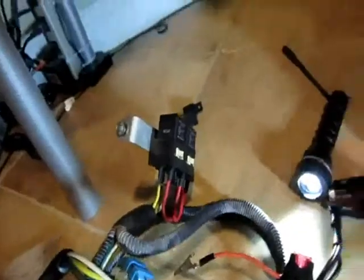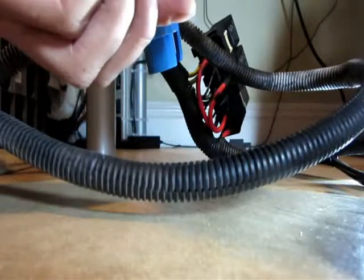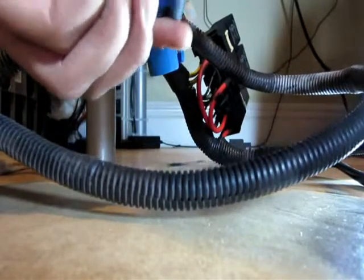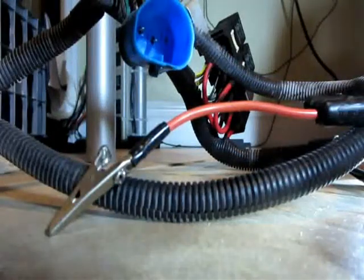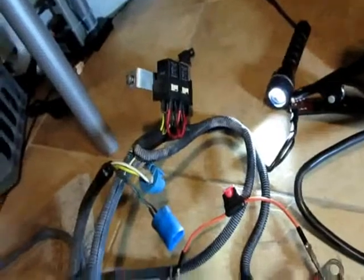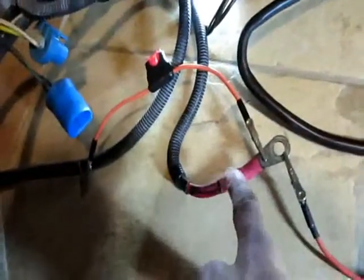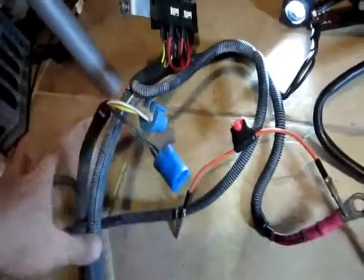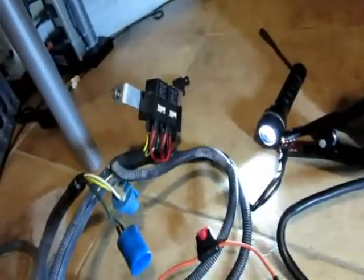It's a better harness — we should add two more relays to it, which is actually pretty easy to do. Testing our circuit here, it is working fine because when I connect power now the relay is not clicking like it was before. So I'm thinking something was shorted inside the car when it was all put together, somewhere between here and up here in the circuit, because that's the only area that gets power. It could not be feeding from the back end — there's no power there.